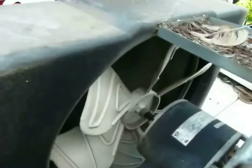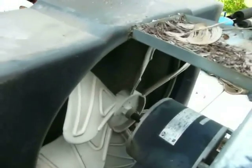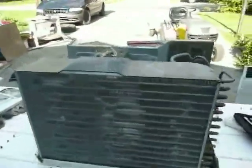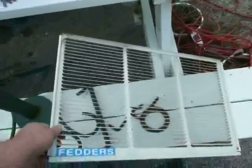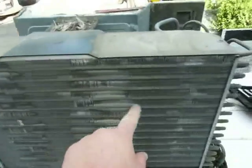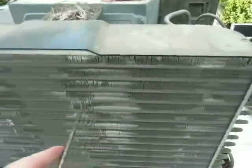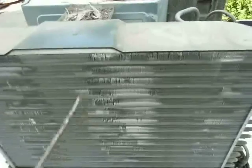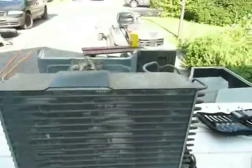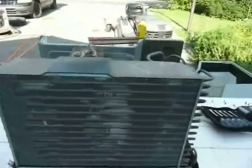Also look in here on the condenser coil to see if it's plugged up with dust like this one is. Then come out and look at the outside of the condenser coil. This particular air conditioner had a protective grill over the condenser, but it didn't really help too much. A number of these fins are still bent over, and the only thing you can do about that is to take a putty knife or a bladed screwdriver with a thin enough blade and try to straighten them out. The straighter you can get them, the more air can flow through there and the more efficiently your air conditioner will function.